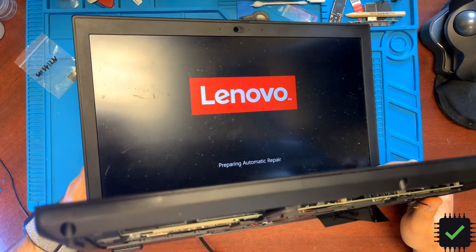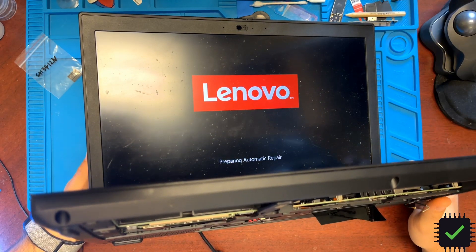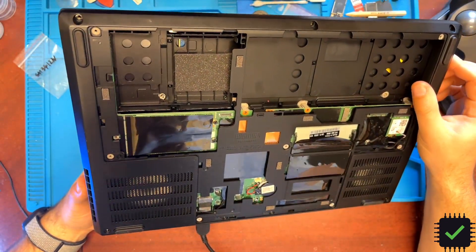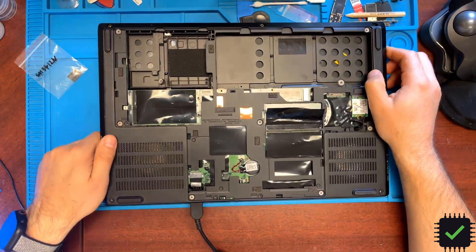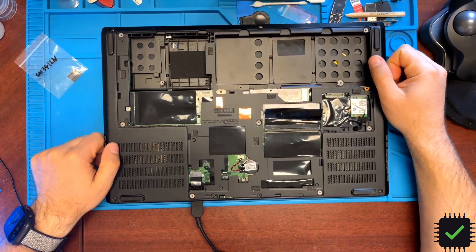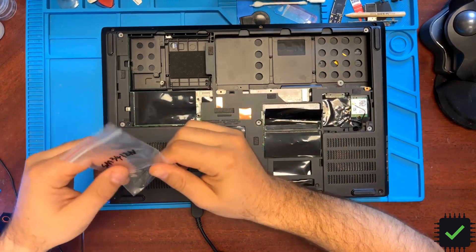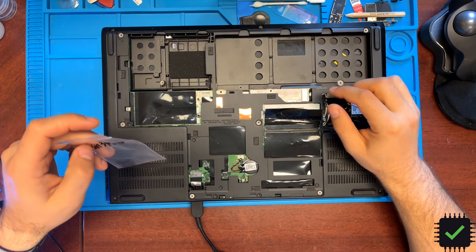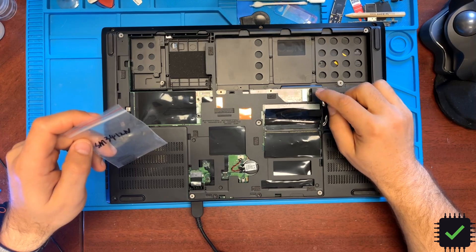So this is just a quick workaround. If all you need to do is to get the laptop to work again without doing any micro soldering or anything like that, kick the battery out and you'll have a working laptop. But if you want to fix it properly, look in this area — it may have the exact same issue with a failed MOSFET SM3412N.